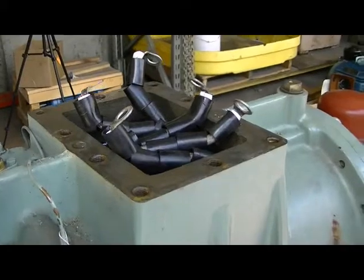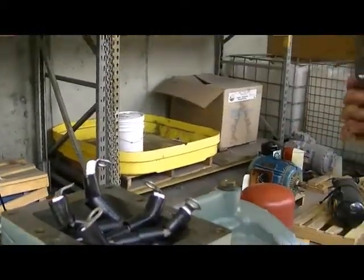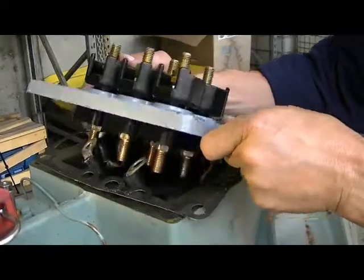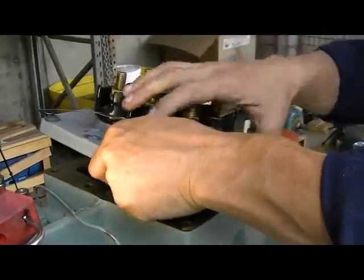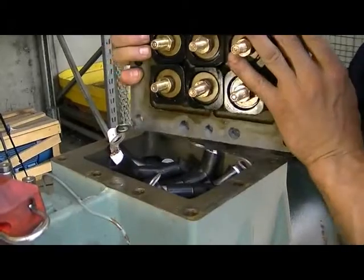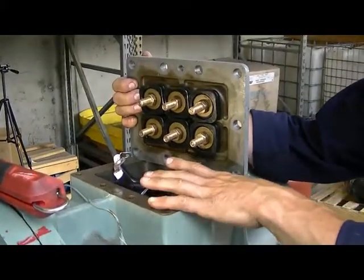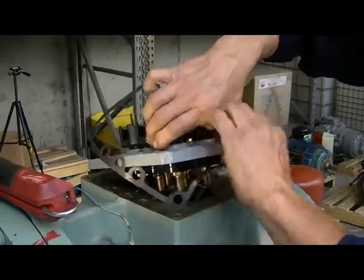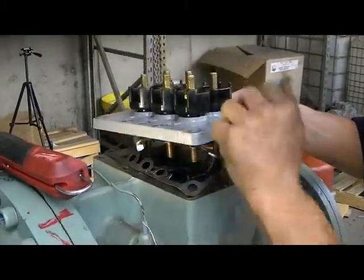When this is going back on, keep in mind: if you have the terminal block out by itself, you can leave the gasket off if you just have the plate. So if you have the plate on and all these wires are connected still, you can still slide this gasket off as long as these are off. I recommend doing that because when you're putting the new one on, you have this leaning up against the edge and you will cut the new gasket when you put it on. Leave the gasket off until you're all done, then simply slide the new gasket on and you're good to go.